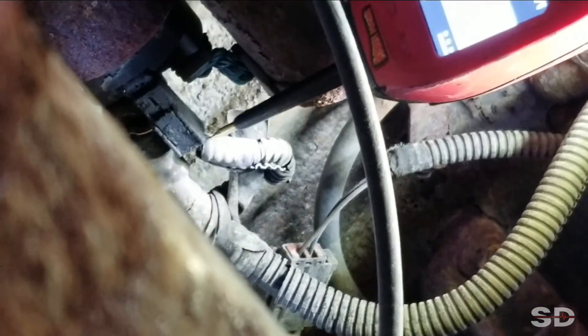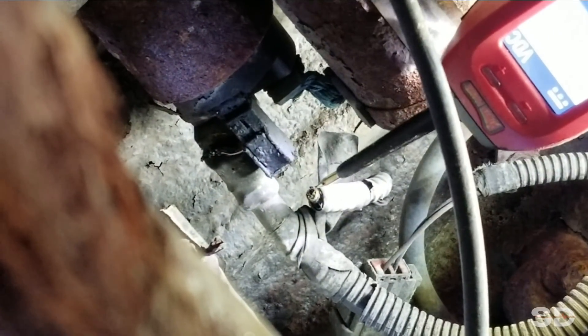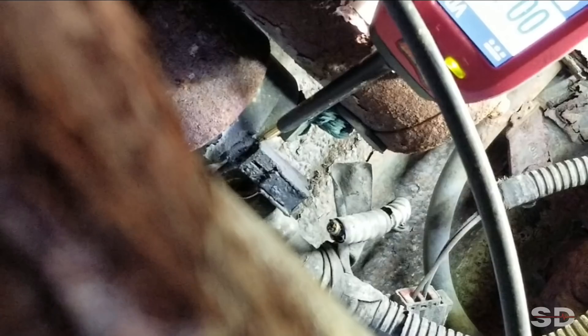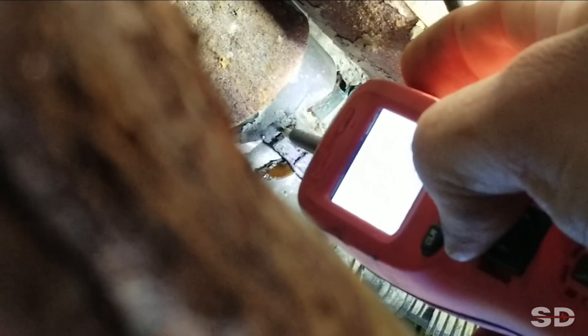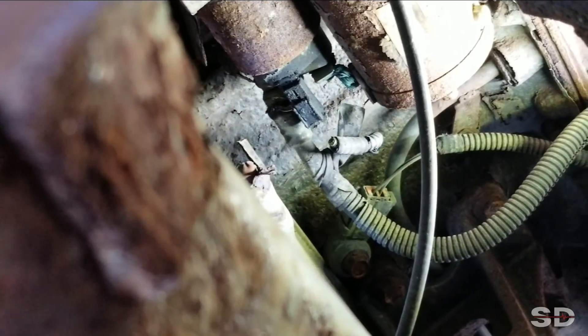Now, when I poke this, it's probably going to end up starting. Where's that burnt now? It just burnt off completely. So what happens is corrosion equals heat. The smoke that I saw when Pete was cranking it was the final piece to that. I don't really want to do this with my power probe because it's about 40 amps to make this thing crank. But if I hit this post, I should be able to make this crank. There you go — broken wire, Pete. Get this in the shop where you can actually work on it. It's an easy fix.